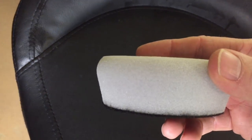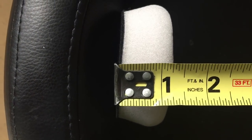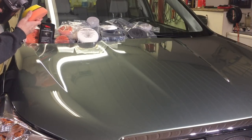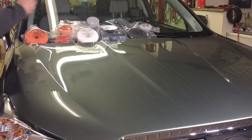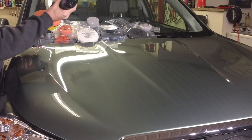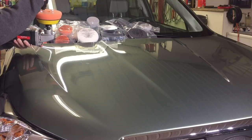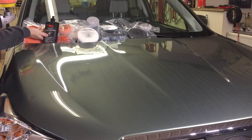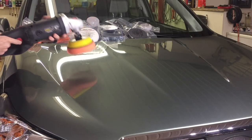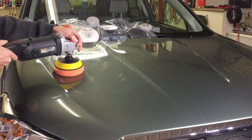When product gets absorbed by many pads out there, that's when you run into trouble. You can see here it's thick — about just under an inch and a quarter. Great on rotaries. The obvious beveled edge serves a couple of purposes: it gives a very nice controlled smooth ride, it's firm, and it also keeps the backing plate inside the pad itself — which is important when you're working up against an edge, an emblem, or a mirror.